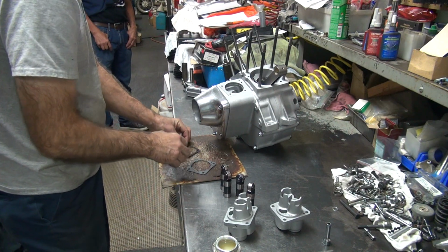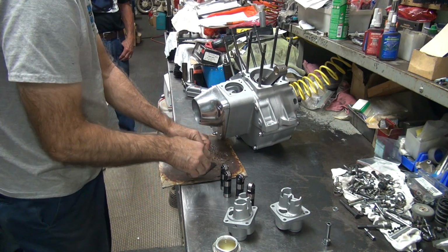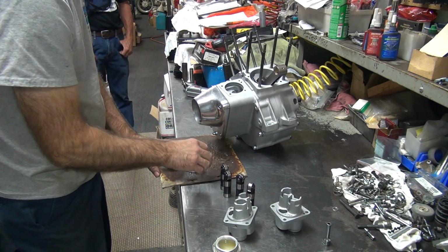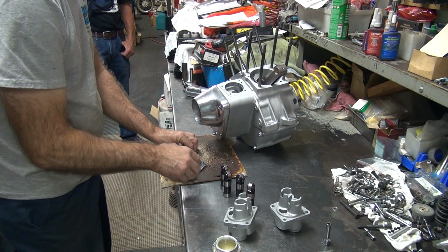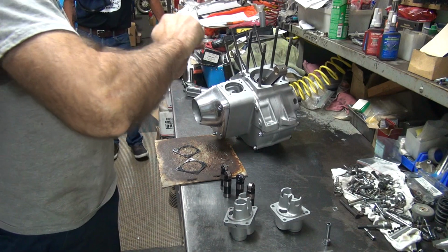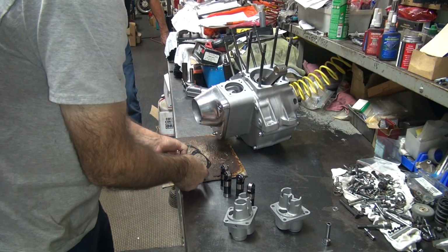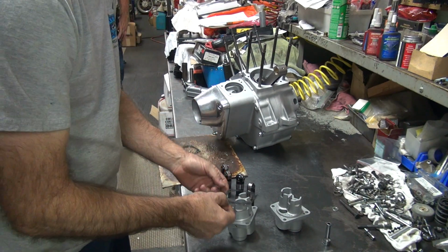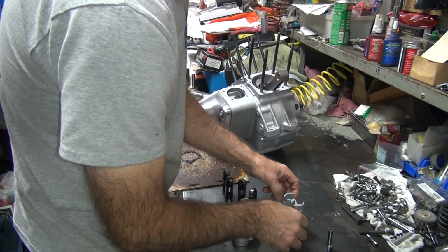So you fixed a hole in that valve cover of yours? I replaced it. That sounds expensive. A friend of mine had a used one. I just cleaned it, zinc chromated it, and I happened to have some Continental engine paint. Painted it, heat dried it. Was it certified? It's a certified Continental part. And I'm certified, so I can put it back into service. You can do what you want with it? Oh, okay. Well, to a certain extent. I'm an A&P, so I can return products to service.